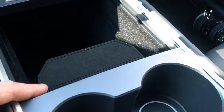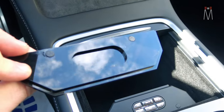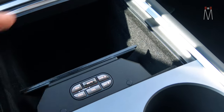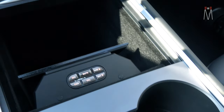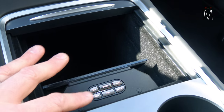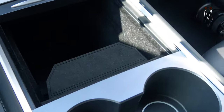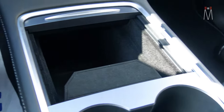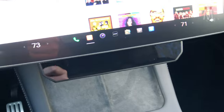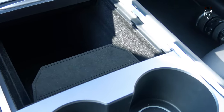Opening the armrest, there's a little platform with an alcantara top engraved with design elements. Pull that off — it's magnetic, with two magnets on the back — and underneath is the cutout for the controller. The front has two magnets to hold the cover when you're using it. Once it's set, you really don't need to mess with it other than the mute button. It snaps back in and looks one hundred percent factory. We also have a kill switch — now it looks like a factory extension of the MCU with no idea a system is in the car.